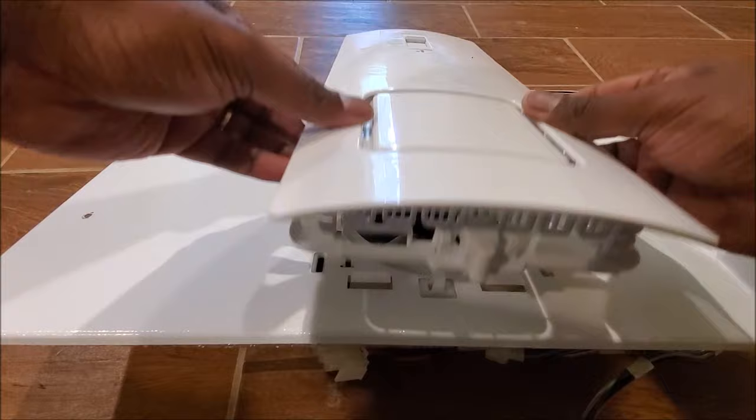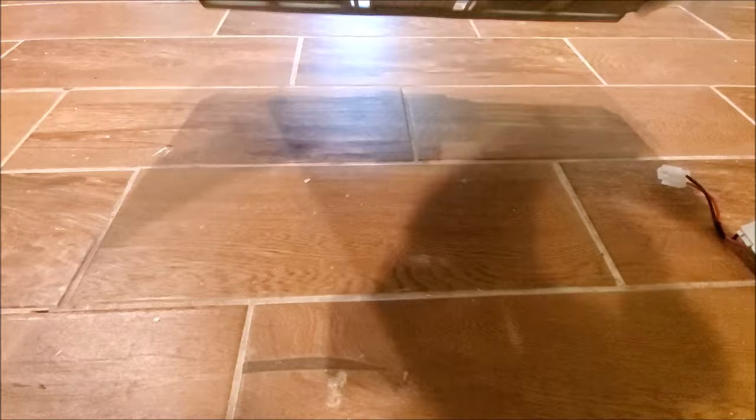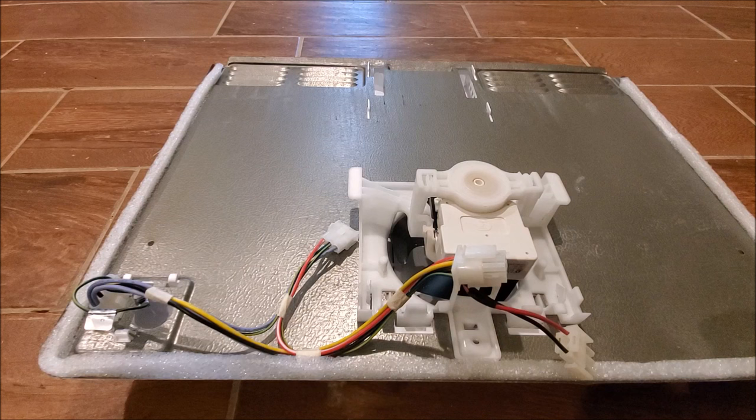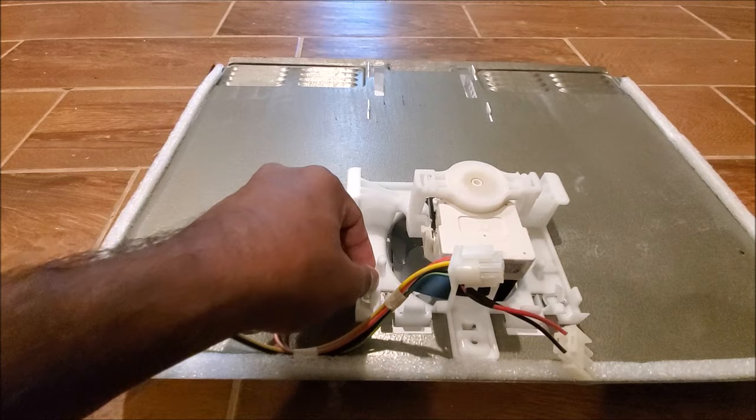Now I'm putting this back. These tabs need to match up with the holes, so we slide them right in, then flip them so you can clearly see them coming out all the way — a perfect fit. The way to keep them snug is to reinstall these little metal clips.